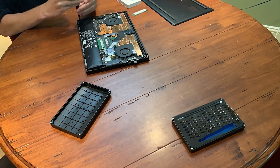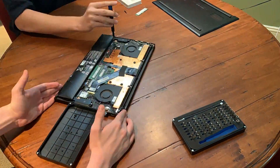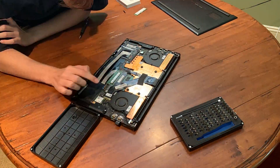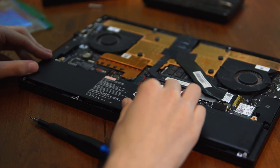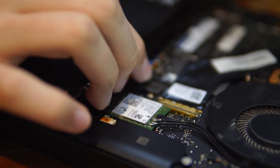To remove the battery, use a screwdriver to gently remove all the screws holding it in place, and then lift it out of the laptop. Place these screws somewhere safe, then get your new battery, place it in, plug in the connector, and then screw it in. Depending on the battery you get, you may have to do these same actions in a different order, just because it might be more difficult to screw in the battery while it's plugged in, or vice versa.